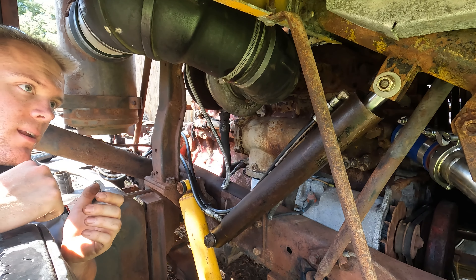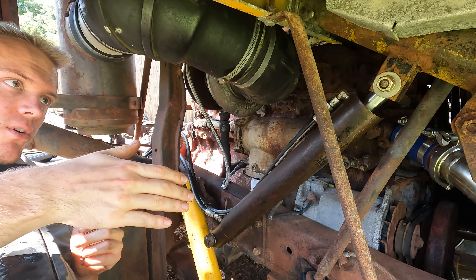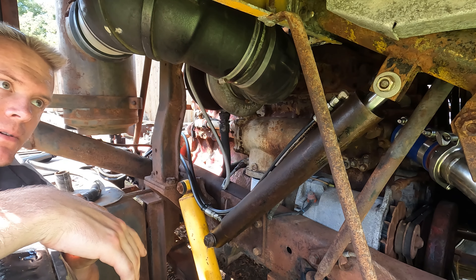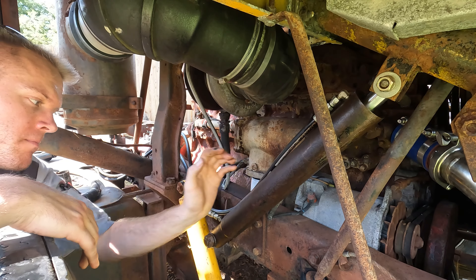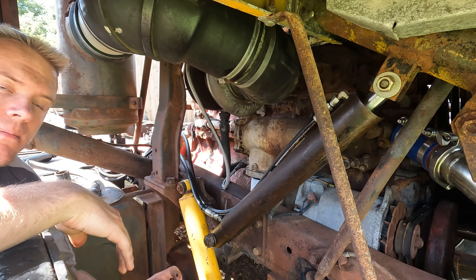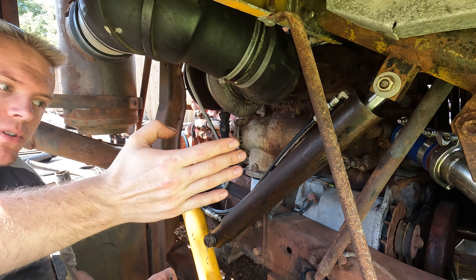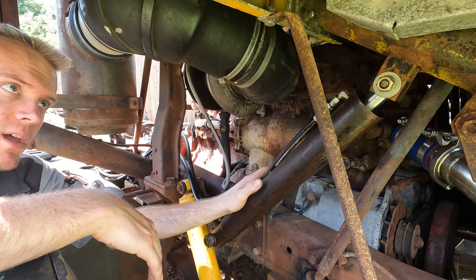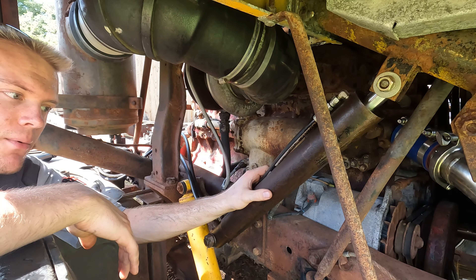If you look at the top, you can see there's a pin eye — it's just drilled through the pin. That's very simple because I can cut whatever attachment is on the stock hydraulic cylinder, grind or mill it down to fit inside the specific flange that's already built. Your main thing to find is your on-center measurement and what your body length will be. Body length generally decides stroke, so you won't have too many options, but more stroke is better because the farther the cab will tilt forward. The restriction on this cab tilting forward is the hydraulic cylinder itself — not the safety cable.